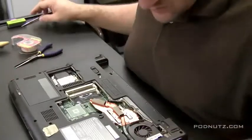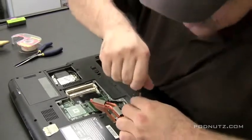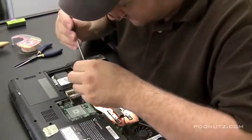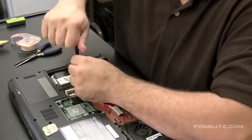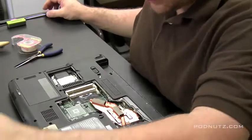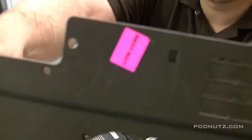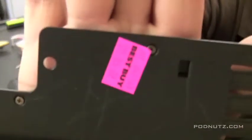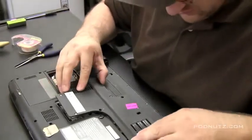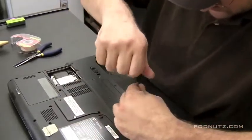Okay, going to reattach that cable. Make sure it's in far enough, the way it's supposed to be. Lock it down. Make sure it's all lined up straight. Then mount the keyboard back. Usually snaps in under the plate there and then push down at the top. And I know that this particular keyboard screws in two spots. One right next to the CPU fan and the other one where the wireless card goes. Two little silver screws. Very tricky. You would not think that they hold the keyboard in, but that's what I learned. Then we're going to mount this plate back on, and then we're almost done.